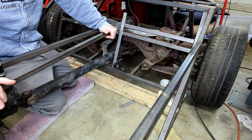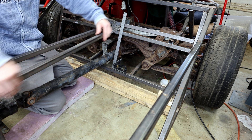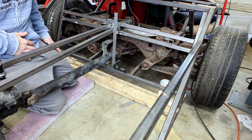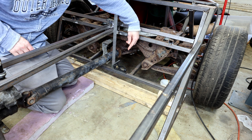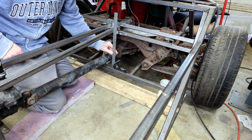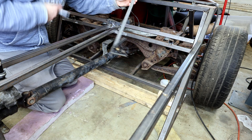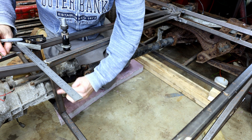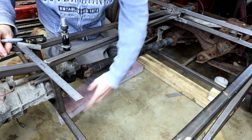I have the upper driveshaft tunnel rails and I need to put the lowers in. They need to be directly below the upper bars, and the way I'm going to do that is by utilizing a 90-degree square to locate where the edge of that lower bar is going to be. That bar will run from the back all the way across here and it'll be right under this vertical in the front, so I know that location.